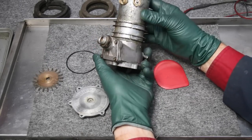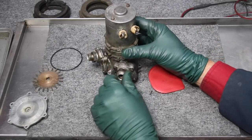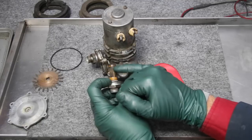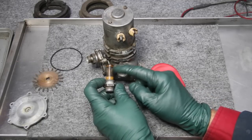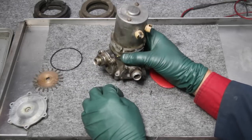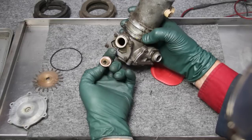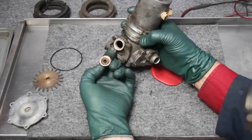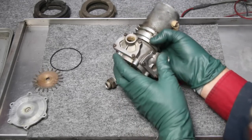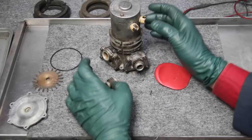I don't have any other information or parts to take this pump apart to rebuild it, but when you have the pump off there are two other things you want to check. This is the inlet coming from the fuel tank — you'll want to check the finger screen. Here you can see the screen's not too bad but it's going to have to be cleaned; there's some crud right up here on the end. I've seen some of these that are just almost plugged. You want to clean the screen. On the other side is a check valve, and this check valve also can get crudded up. Look at how corroded that check valve is. You can clean these up and check them by blowing on them — you can blow one way and can't suck the other way. I've got some cleaning to do down in here too; there's quite a bit of crud. I'll have to get a brush and really clean that out, then get ready to put this thing back together.